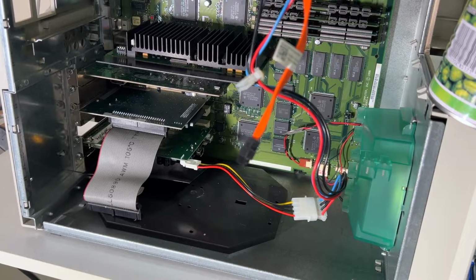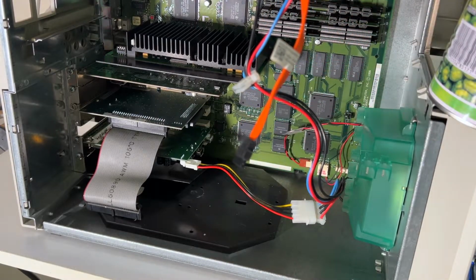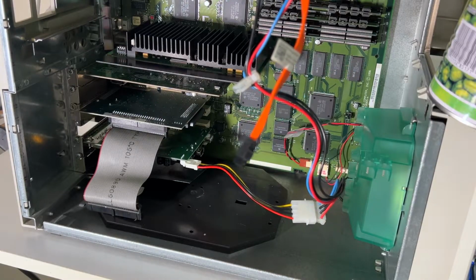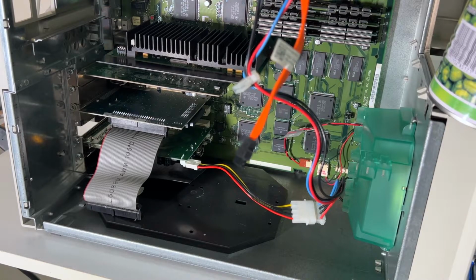Now, why that would be is because the 9600 has a weird quirk with G3 upgrade cards. As I mentioned earlier, this is a Tsunami 9600, not a Kansas 9600, and the Kansas board has some modifications, specifically with the ROM, which I believe is right here in these four chips, and the L2 cache, which is these chips right down here. On the Kansas board, those L2 cache chips are gone, and that's because the Kansas boards let the CPU L2 cache run the show.